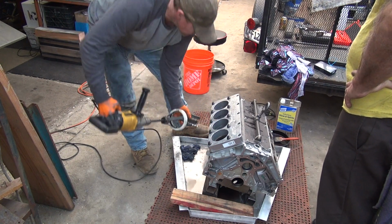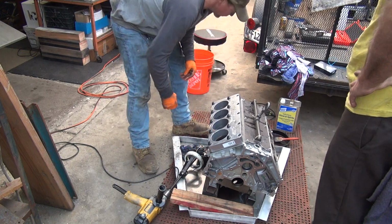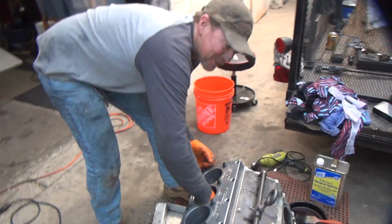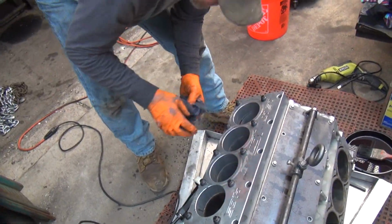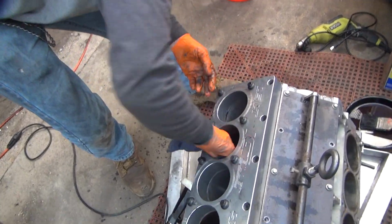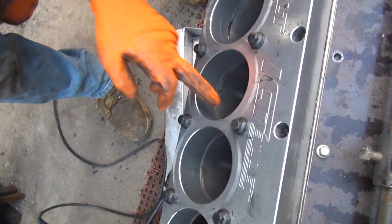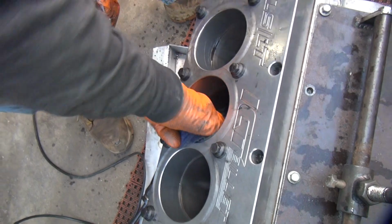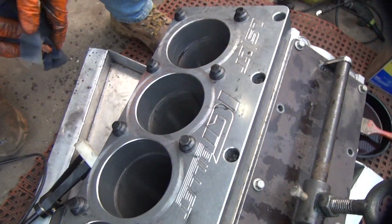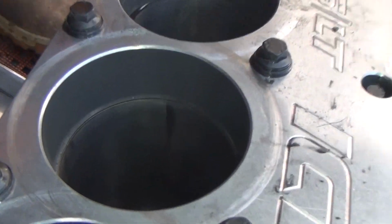You don't want the coarse grit, they stay in there for a while. Oil retention grooves? Yeah, but they're vertical grooves, the kind that bypass boost. That's called bypass pressure grooves. Yeah, we don't want those. Those are not wanted, like that one right there. Well, they're going to be in there. These nice ones in there. Oh yeah, look at that. Oh, there's a good one there. Oh, what's that? Okay, that's what you don't want to do.